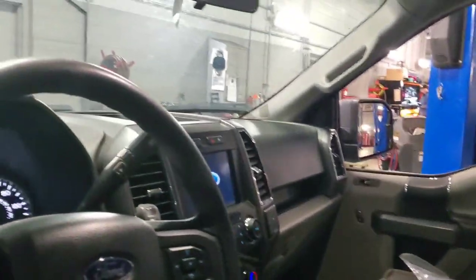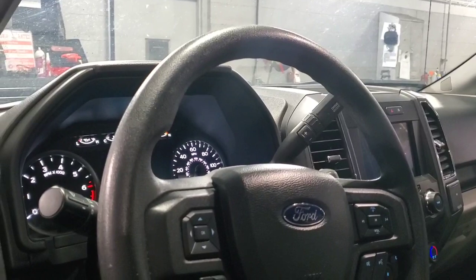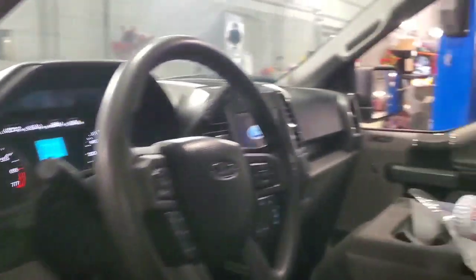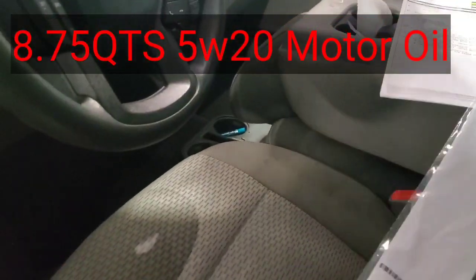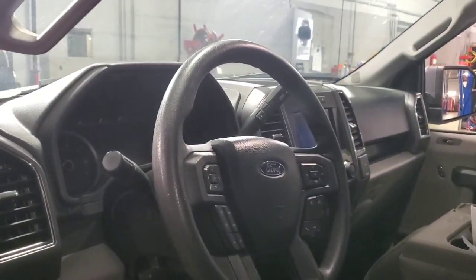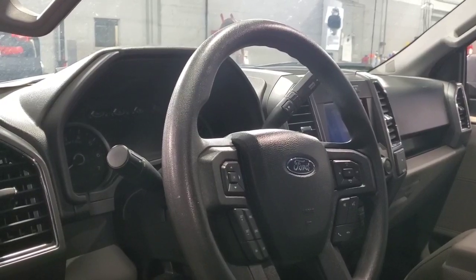It's something to do with pulling an excessive amount of vacuum, and it pulls oil into the intake manifold and then into the engine. What they have you do is change the filter, put in 7.7 to 8 quarts of 5W-20, install a new dipstick, and then reprogram the computer so it can control the downshifting event — so there's no loss of oil while it's shutting off and reactivating injectors.